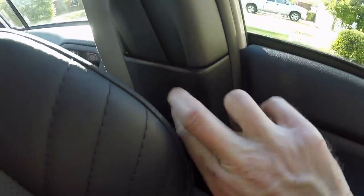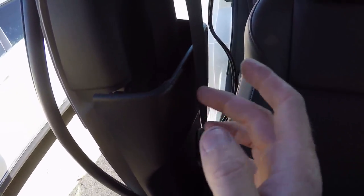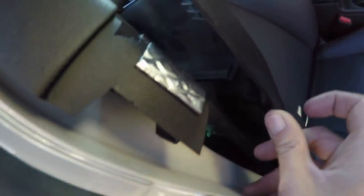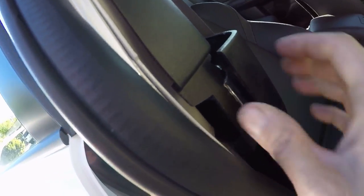I'm going to do a couple of padding strips on this piece against this metal to stop the final rattle. I'll do some Dynamat strips at very careful places to get it tight and then we're done. Actually, this isn't the hitting point between those two pieces — it's this piece to the metal over here. So all you need is some Dynamat right under that contact point — just lift that up and put Dynamat under there. That is the key.